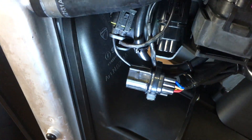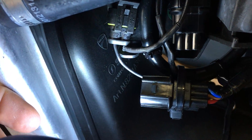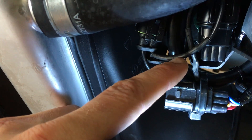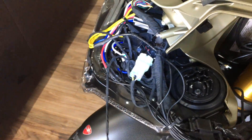If you look down here, your fan pulls off the lower radiator, and if you look at this switch — this plug right here — it's got a one and a two on it. Number one is the positive for the fan, number two is the negative. So what you do is you cut that wire, the number one positive wire, and you're going to run one end of it to the relay. I'll show you the route I took — just kind of up along here behind this plastic, joined up with this harness right here, and I actually came all the way to the front of the bike.